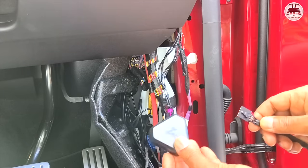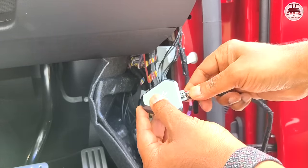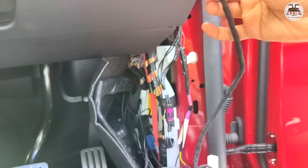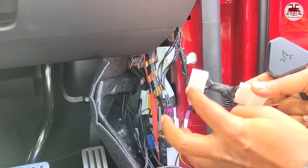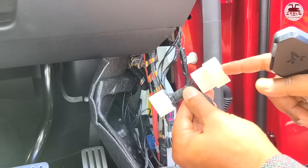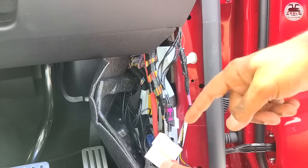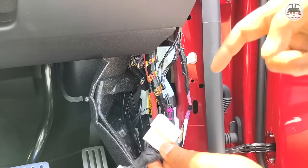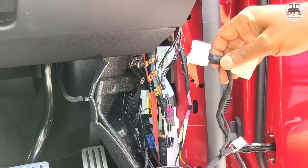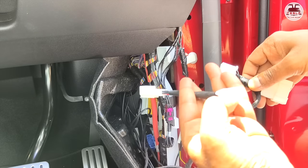Because the space may be a little tight, I first like to connect the commander plug — it's a very simple thing; it comes with its dedicated clip. You plug that in there. This one will go into the female of the OBD port plug, which is the blue plug, and this one is where you have your existing OBD. After that, you just need to plug the power source — I'll show that in the next step.